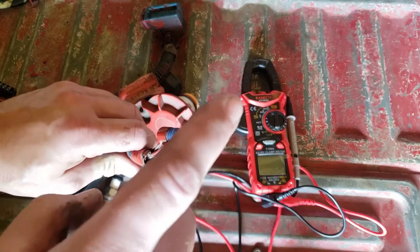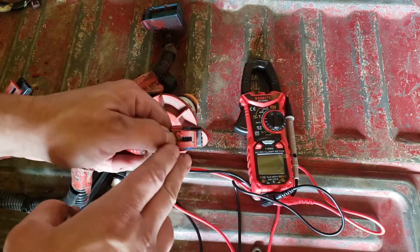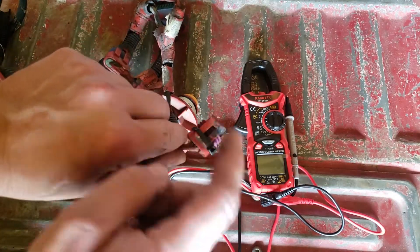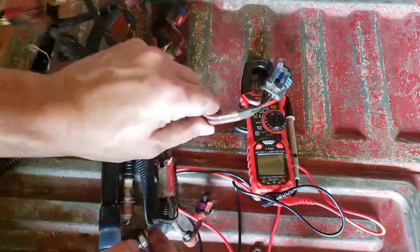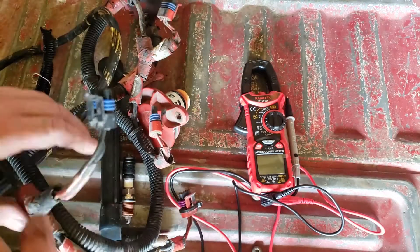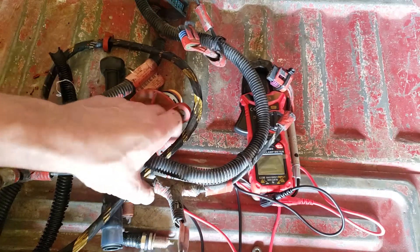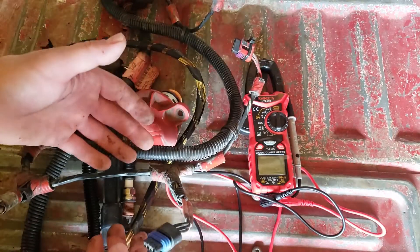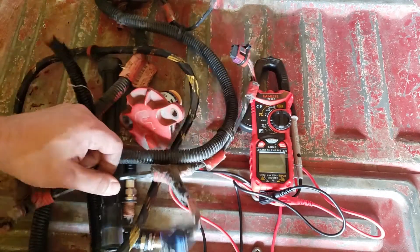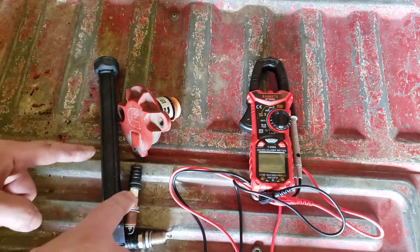You do not put dielectric grease in your harness connections — keep them dry. You can maybe put a dab of dielectric grease around the seal, but dry. If you have a problem — say these crack, get brittle, break, or get old — don't use a zip tie. Cummins makes connector kits and you can make the connectors yourself, where you can splice these in. Or if the harness is already that old, you can replace the harness; it's worth a couple hundred dollars just to do it.